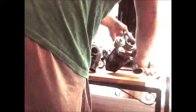Now, when the wastegate fails, the turbo will not spool or anything. And when it fails, numerous things can happen. I don't know if you can see in that one, but the wastegate is actually melted off, and this wastegate is seized. It got stuck shut, or the push rod's bent or something, and the wastegate melted. So this turbo is actually probably no good. The insides are probably good, but the wastegate's melted.